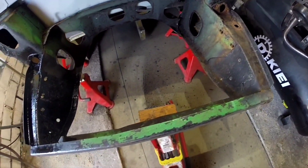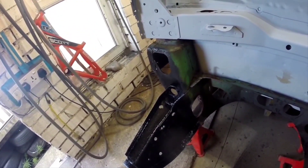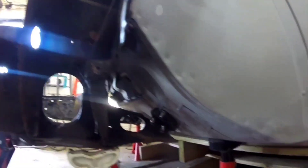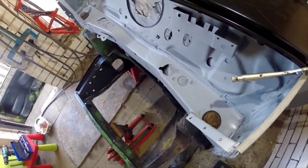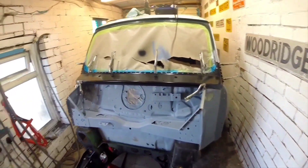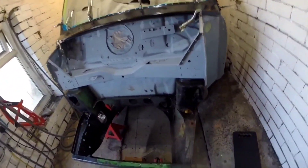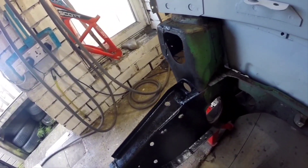Well, it's pretty dirty, this thing. But that's what it could possibly look like if you'd had a bit of a strip down and some rust protection on it. That doesn't look too bad, does it? Both sides are in, the top bolts are in. I'm not buying new bolts so I'm just going to clean them up. I've got new rubbers for them, new rubbers for under here, and new rubbers for there. So I'm ready to put those new wings on next weekend. That's what the subframe would look like — not bad, is it?